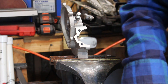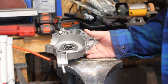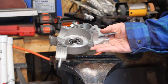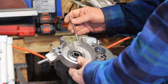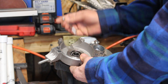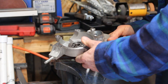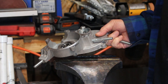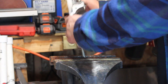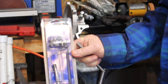So if you need to put a helicoil in it, I would recommend, unfortunately, the best way to do it is to tear it all the way down. I have seen it where people — even at the factory — drove the stud all the way in and it cracked the case, and the stud even seized up the crankshaft assembly, in which case we had to swap the case out and completely rebuild it. But if you've only stripped the threads out in the engine, there's a fix, and that fix is going to be a helicoil kit.